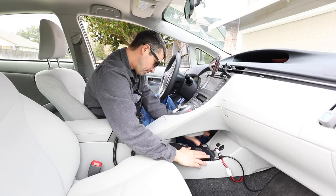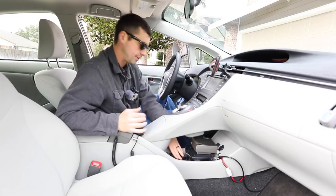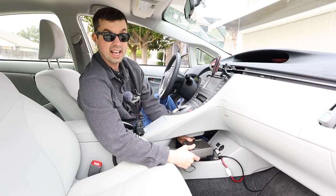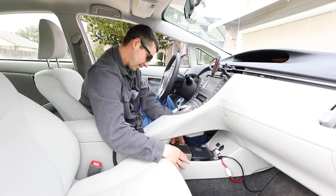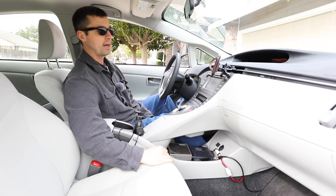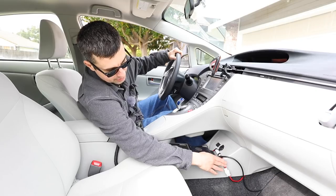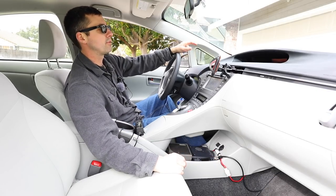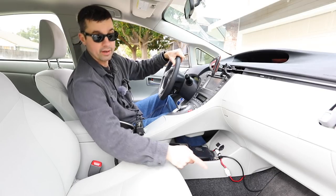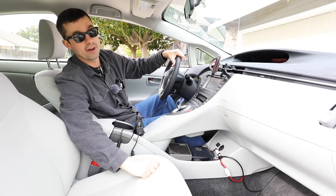The radio itself is right under here in a pass-through area in the car. The cable I needed was included to connect the remote head, and I had an older CB radio speaker laying around — that cobra plug plugged right into the back and it all just sits in there. Nothing is mounted; everything can be picked up and pulled out. When we go places in the RV I'll grab it out and mount it there. I got lucky with this car: the battery is in the trunk, not the engine compartment, so I just ran the power cables underneath the carpet through the trim.